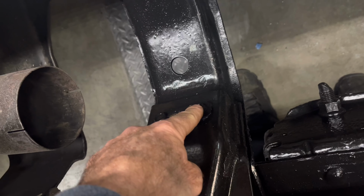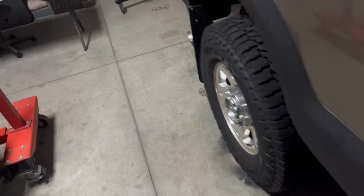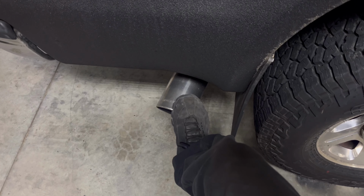That bolt right there, you can go back and put your foot on the tailpipe and test it. You touch it right there and the noise goes away, then you know it's exhaust. I mean, sometimes it'll feel like a torque converter or flex plate. And it'll feel like all kinds of things are going on with the truck. You've got a strap on it trying to pull it back. Let's just see how bad it sucks.